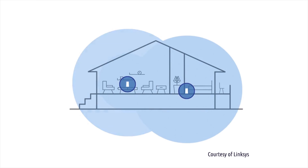If you put the router on one end of the home, the circle is going to extend outside the home and only reach halfway through it. So if you live in a ranch style setup and you're having a reception problem on one side of the house, it's because the router is not in the center. You might want to consider moving the router to the center if possible. If not, you'll probably need to get a mesh system to tie two routers together to blanket the home for better reception.